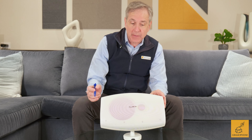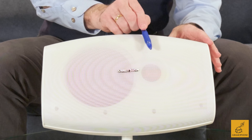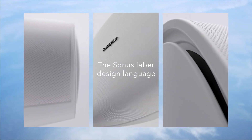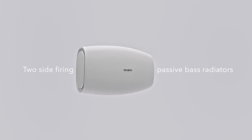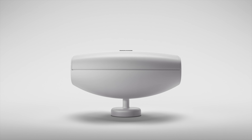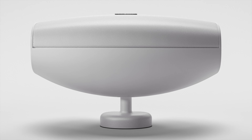So let's see what you get with Sonus Faber Aster. It has a five-and-a-quarter inch bass driver and a one inch dome tweeter. The sides have bass radiators on both sides, and those twin bass radiators are really important because the speaker has a pretty healthy bass response, which is really nice. The cabinet is UV-impregnated ABS plastic, and the grill is a treated metal mesh so you won't have rusting of the grill within a year or so, which you can get with inexpensive outdoor speakers.